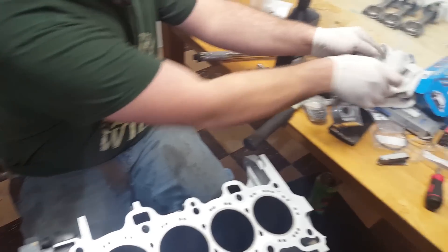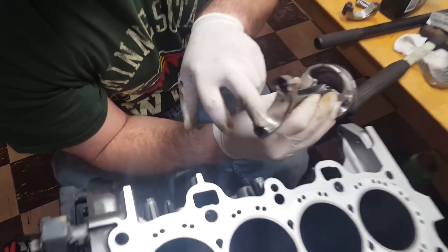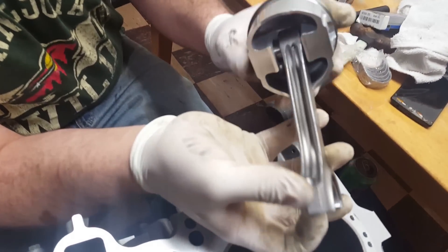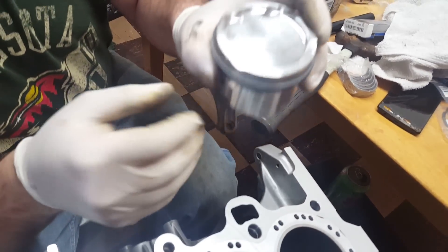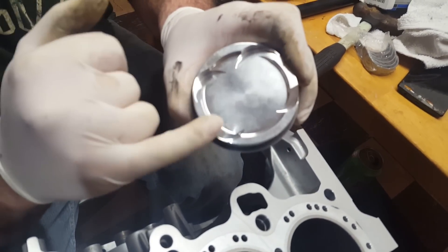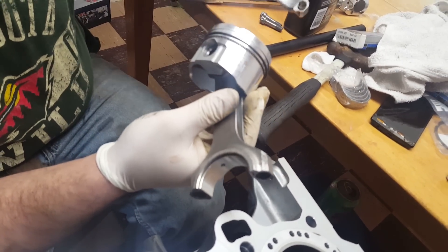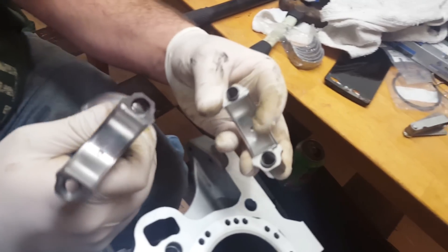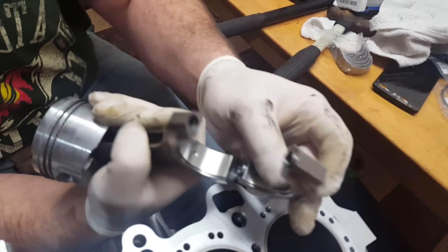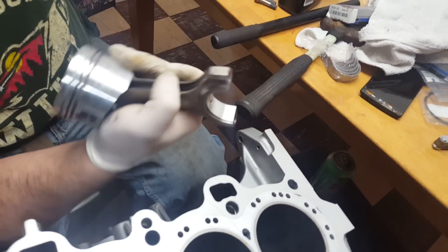For the people that don't know: this little notch on your bearing — see how this side is bigger, a deeper indent — that's your intake side. That notch always goes to your exhaust. And on the bottom of your connecting rod cap it always goes in line, so it pretty much interlocks those two little notches, just like that.